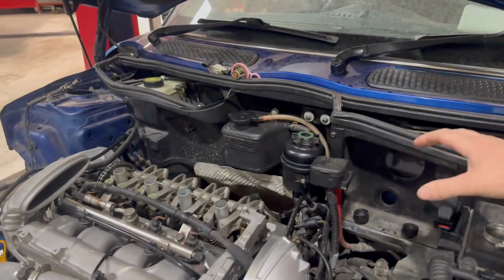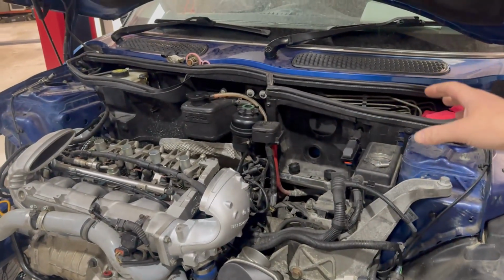We're also going to have to put the airbox back in along with the ECUs, and they'll obviously be changed for the John Cooper Works ECU. Then be onto the cam cover and the intercooler. So it's really coming together now. Going to be putting oil in it, changing the filter, fuel filter as well. Then we'll also have to change the ignition barrel and the little, I think it's the EWS module to get it to run on the John Cooper Works ECU. So we'll do that now and we'll come back and hopefully we'll have it running.